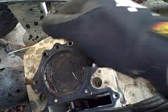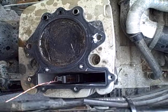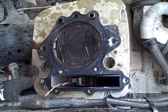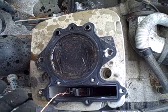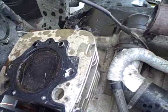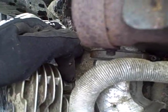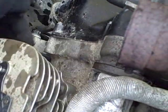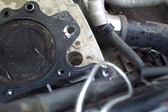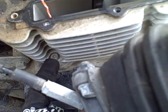It stopped again because I inadvertently forgot I needed to be holding the timing chain - the timing chain folded over itself, but that'll be easy enough to correct once I get the cylinder off. Now I'm going to remove the cylinder, which involves removing two nuts on the back side at each corner, two bolts down through these holes, and two 5mm hex head screws here and here.